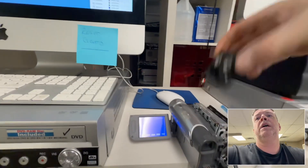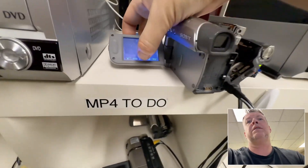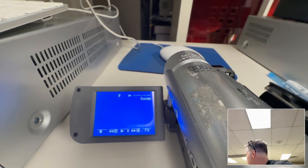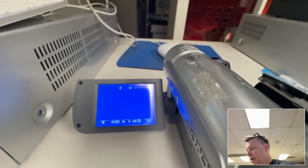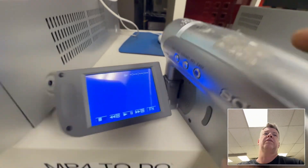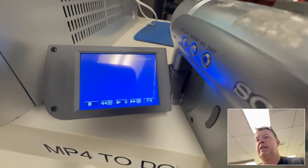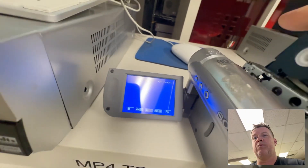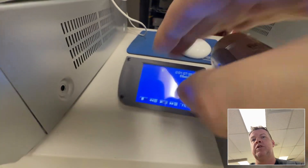So what you have to do is put in a head cleaner — just a basic first step. Put it in there, run it for about 10 seconds. You might have to run it multiple times. Could be the player. All of these tapes are just dumping oxide — magnetic oxide — on the heads constantly. It could be a problem with the camcorder. Back in the day, the kids dropped it at Disneyland in 2005. You don't remember what happened 20 years ago.